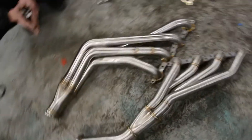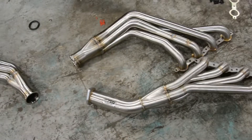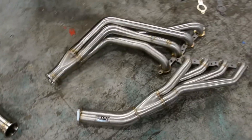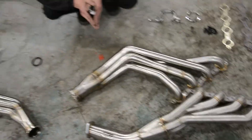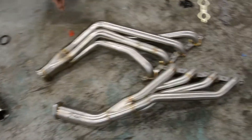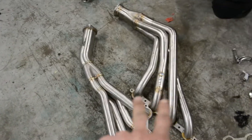The uneven tube length would affect sound, but not to an extremely noticeable extent — unless you went from one to the other you might be able to hear a difference. There are so many other factors like long tubes versus short tubes, different exhaust setups — a lot goes into it. There would be a slightly different sound but you wouldn't really notice that much; it would really depend on what comes after the headers.